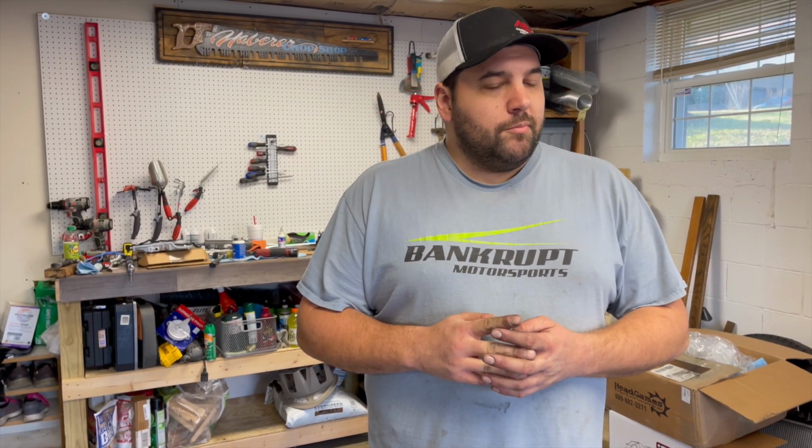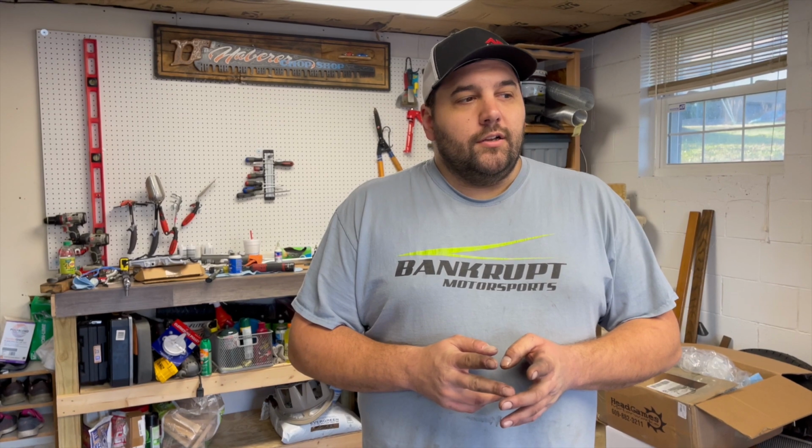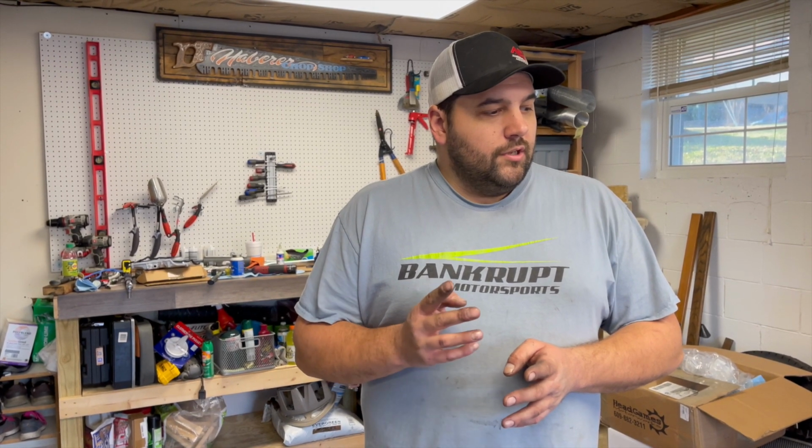Alright guys, that's going to conclude part 1 of the Bankrupt Stage 3 build. So, we got the heads on, cam clearances checked. We started to put the valve covers on, but because we bought new parts, we're missing a few things as expected. So in the next video, you're going to see us do the oil pan, pickup, headers, engine mounts. We'll seal the valve covers up, and then we'll do the timing and everything.